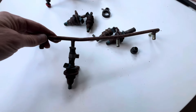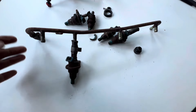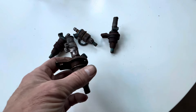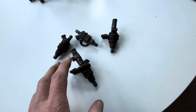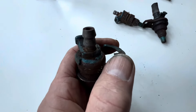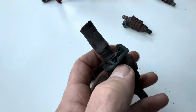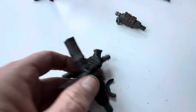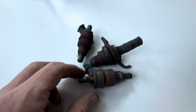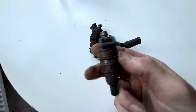There are plenty of videos showing people lifting out the fuel rail with injectors and seals coming out beautifully, but in real life it's often not that simple. In the rest of this video I'm going to show you what it actually took to get the fuel injectors out of our rusty 450 SL parts car and give you tips to avoid damaging the injectors — because when we came to remove them, three out of eight were damaged. One had a cracked top, one had a piece chipped off, and one looked like a rat had gnawed it. In all cases, someone had likely tried to pull the injectors out using mole grips around the plastic, which is a big no-no — you will damage and crack the plastic.